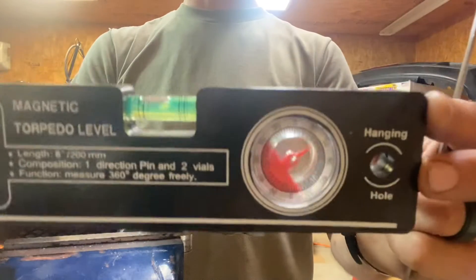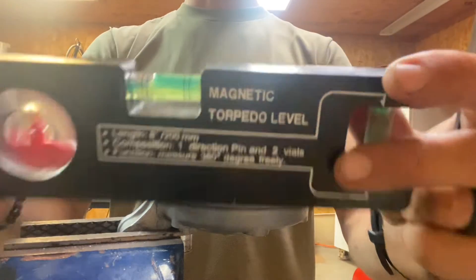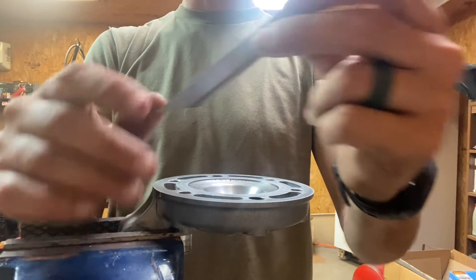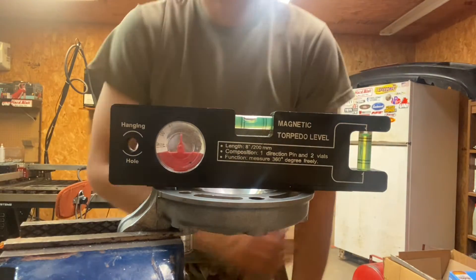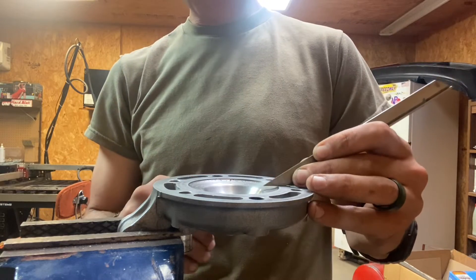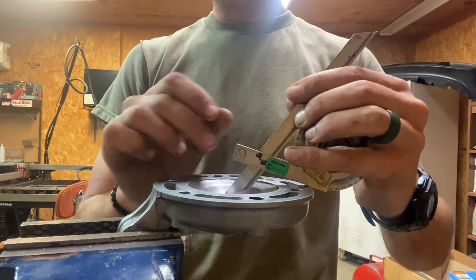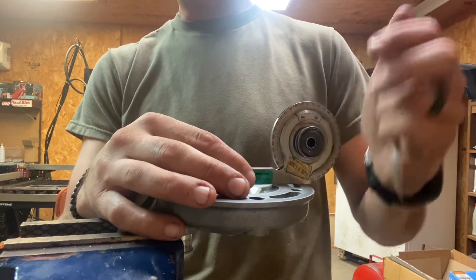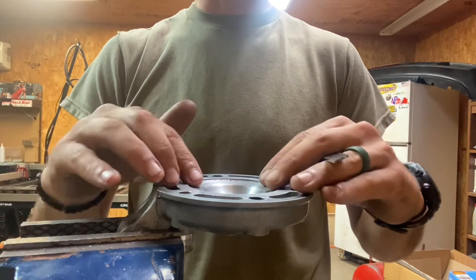I also have this level that will show in degrees where you're at. So I tried a few things and I think I figured it out. What I did was use the 30-degree side, put the head in the vise and leveled it to zero. Then I put the 30-degree edge in where it fits nice and level on the squish band. Even if I could get this down in here — because it does slide through — it would have been off the deck surface. I think this is the true level of that surface coming off the inside wall of the chamber.